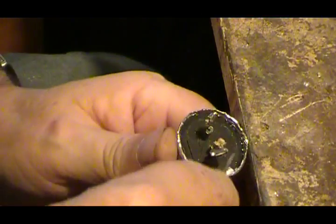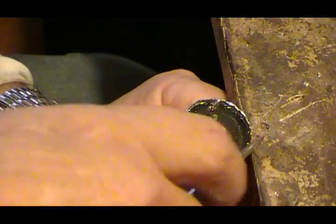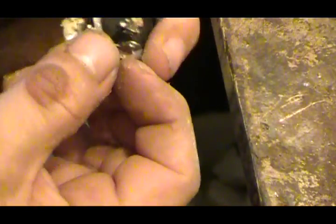I don't have the heat gun out to pull this. Some of these are not too bad. You can kind of come in here and just kind of pry against the top a little bit, just to kind of clean it up. I wasn't sure if this one was going to need heat, but it didn't need heat — it had no tar in it. But that's how you take it apart. There's that little aluminum piece that was giving me a little bit of trouble. It will come in over top of this, and sometimes they'll just move out of the way. This one was doubled over. So generally when the ring is sitting on here, it sets over top of that ring — and then a crimp. This is the negative. That's all there is to it.